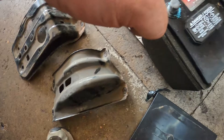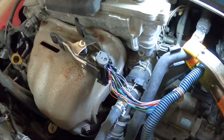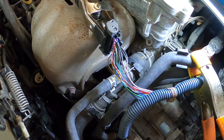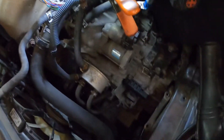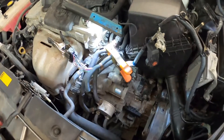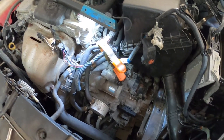These two battery plates go back in, the battery all goes back in, and that should take care of this one. So if you have a RAV4 that's got a lot of codes in it for electrical issues, check this connector on the bottom of the transmission where mice can climb up and chew the wires. All right everybody, thanks for watching — please subscribe and give me a thumbs up if you like my automotive videos.